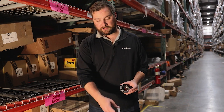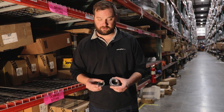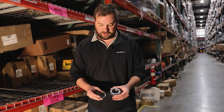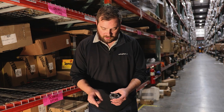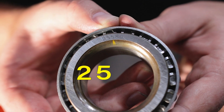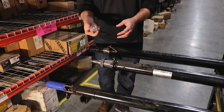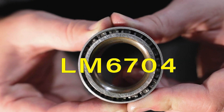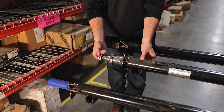Now if you're trying to figure out if you have a 5,200 pound or a 6,000 pound axle, your go-to place is going to be to look at your bearings. Your bearings are going to have an identification number. For this kit in particular, we know we have a 5,200 pound axle. On our inner bearing — which is going to be the larger of the two bearings — we have a 25580, and then the outer bearing is what's going to be the different part. For this one, it is LM67048. So we can look at that and then look at our chart to verify what size axle we have.